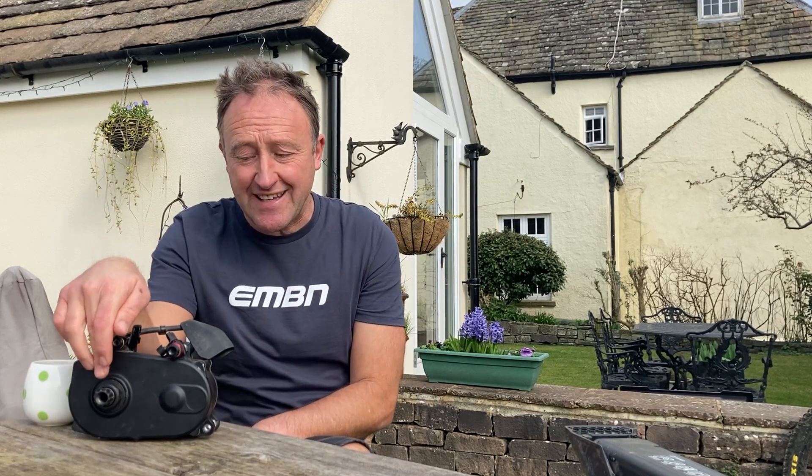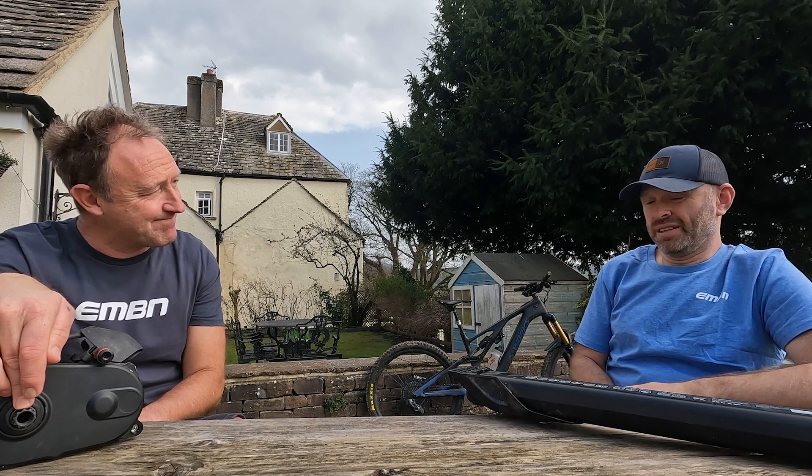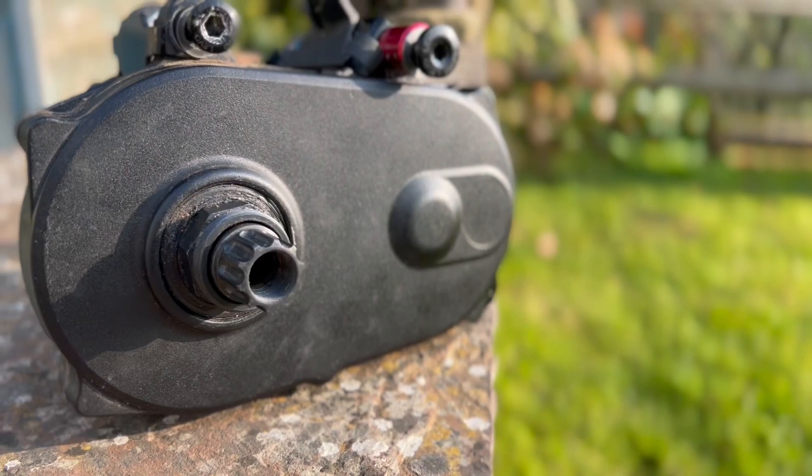So 720 watts - that's one number. However, 720 watts is not the amount you're going to be getting out of the cranks. What you're getting is 560 watts. When you're converting electrical energy into mechanical energy, like we have in this Brose motor, you get a lot of inefficiencies. That could be state of charge, condition of the battery, the state of the motor, ambient temperatures, heat. So that motor is about 75% efficient - that's where we get 560 watts. So we have electrical input power and we also have mechanical output power.